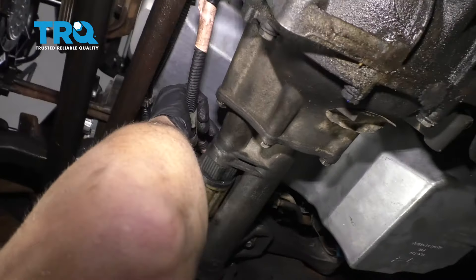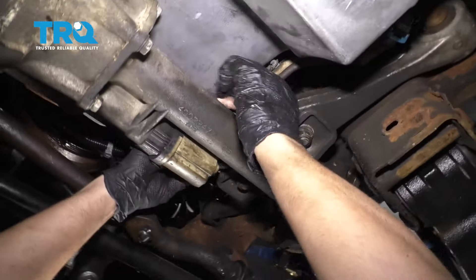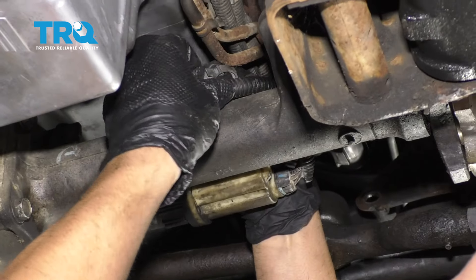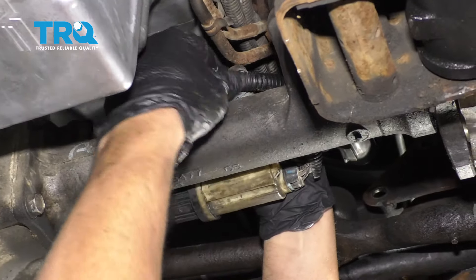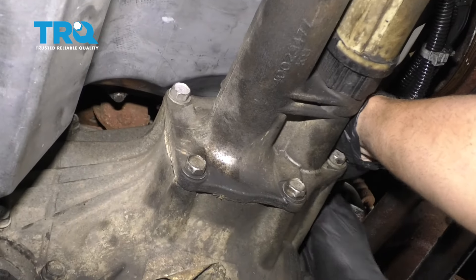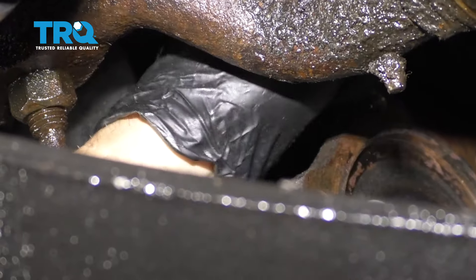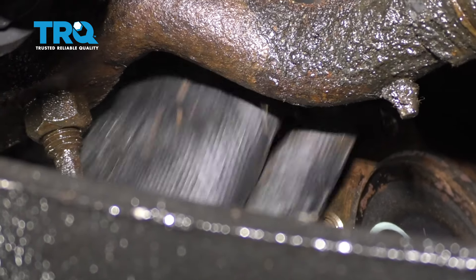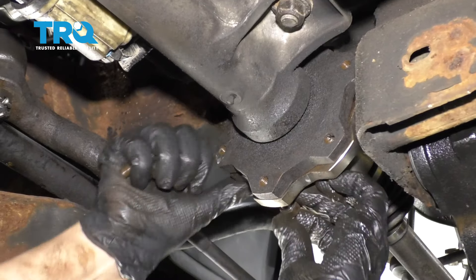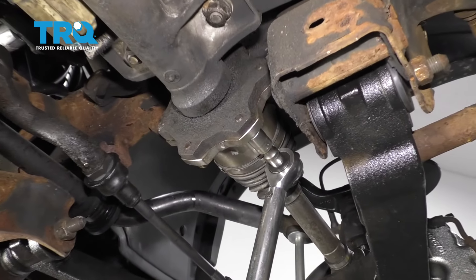We can hook up the wiring harness just to line this up. Plug this connector in, and then where the wire retainers are, just hook the wire into those and lock those down right there. And then there's another one up here and another one way further up. And hook this vent hose up. Now line up the front CV shafts and put the bolts back in. I'm just gonna hold the rotor with the pry bar to prevent the axle from spinning, and then torque these to 58 foot-pounds. And then you're gonna do the same on the other one.